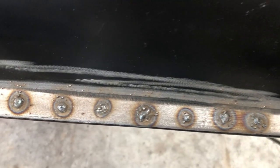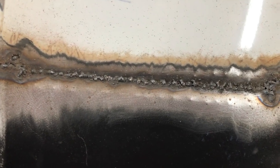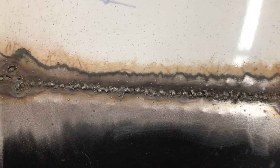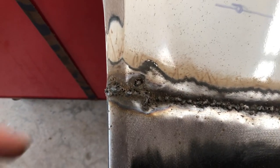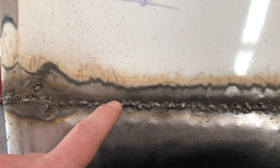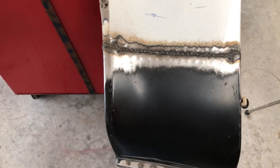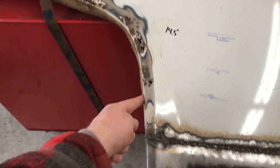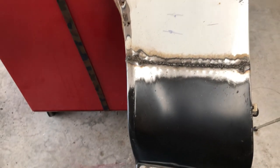So the bottom portion is plug welded in — doesn't look too bad. I need to hit that one one more time. Coming up here, my welds are absolutely hideous, and like I mentioned before, a lot of spatter and a lot of slag to clean up. I burnt through a couple times on the ends so I kind of got myself in a pickle, but I'll get that fixed up. We'll get these ground down a little bit, see if they look any better, see if there's any spots I need to hit again. Overall, the placement is perfect. You can see along this wheel arch, except for my little bit of weld that I need to grind down, there's a nice line all the way down and it's not looking too bad.